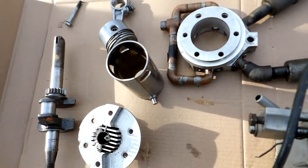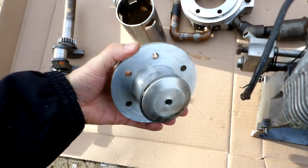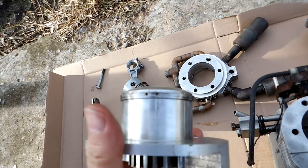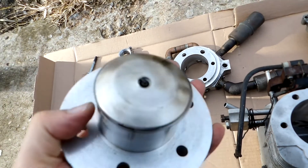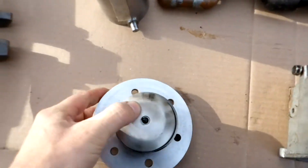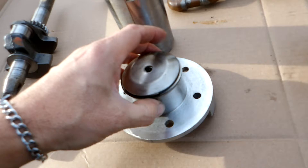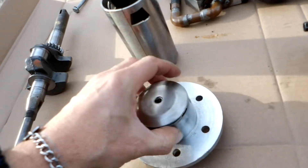To go along with the port area you need what's called a junk head. It fits inside the sleeve just like the piston does, and it's got two rings on it — I just used standard compression rings from Briggs. There's a pin in the groove that stops the ring from being able to turn around, like it normally can in a piston. Both rings are pinned that way — you want to keep those rings stationary in the head so they can't hook on a sleeve port and get caught and snap. It's similar to what two-stroke motors do.